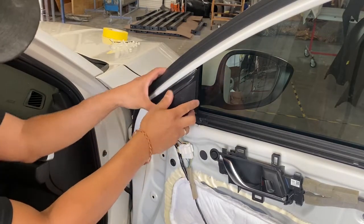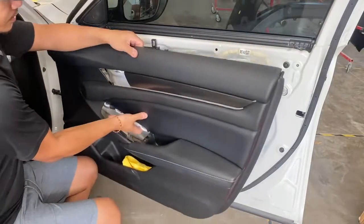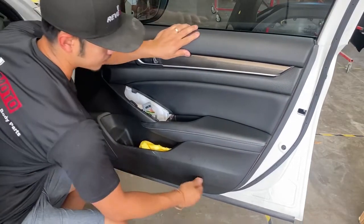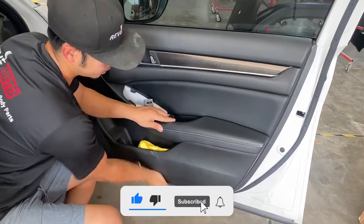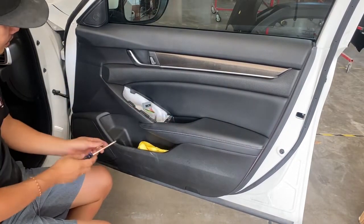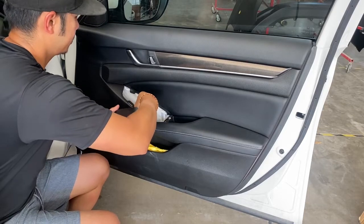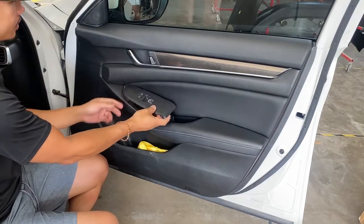Go ahead and push this one back into place, and then let's get our door panel. First and foremost, get that power cable and insert it back into that hole right there. Then go ahead and lift up like that and push it in place — you should hear a clip click. Once it's clicked on, that door panel should hold steady. Then go ahead and put that screw in there. And then plug in that controller or window control — you're going to hear that click. Slide this in first and then push down.